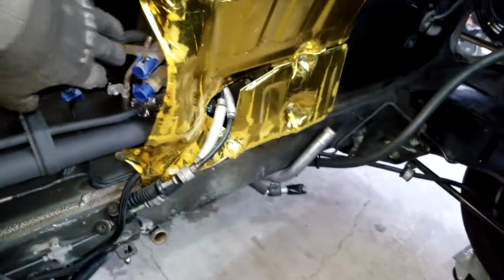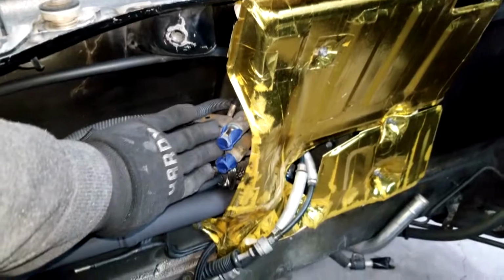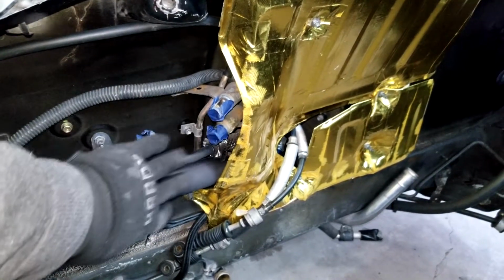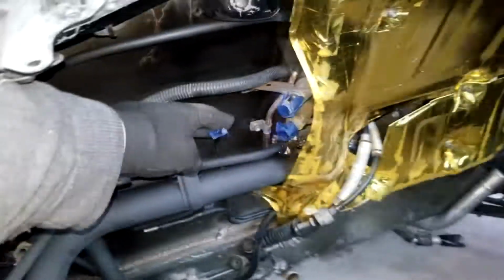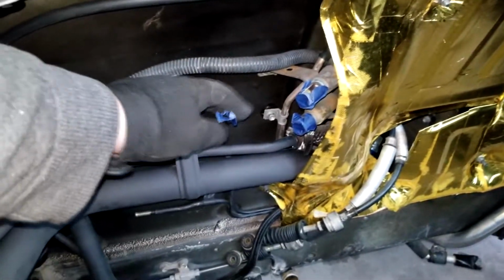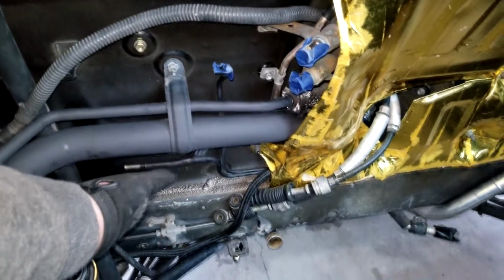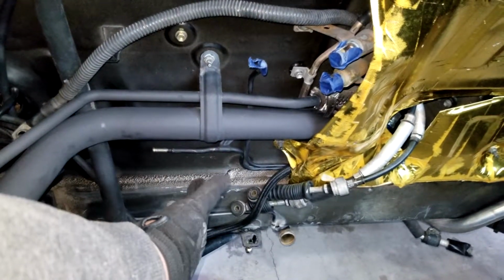So these are the stock heater core lines, the hard lines. He's going to retain his heater, so we're definitely going to be using those. This is the stock fuel return. It's about a 6 AN inner diameter, and this is a fuel vent. This one down here, not this. This is the main filler hose or main filler neck. The fuel feed goes through the bottom there.